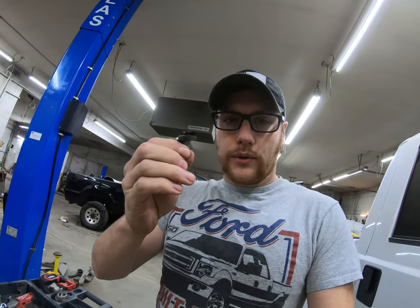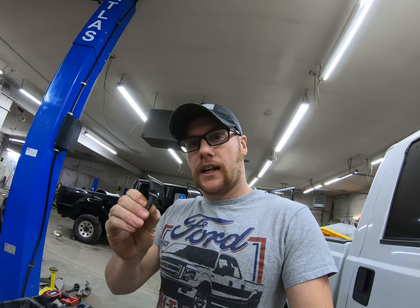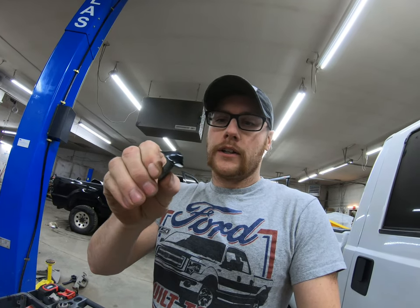If you have a bolt that you can't get your finger on to get set, and you need to put it inside a socket and hold it inside the socket, use a little bit of electrical tape on the head of the bolt. Trust me, it works. You can use this on the bolts or the nuts.